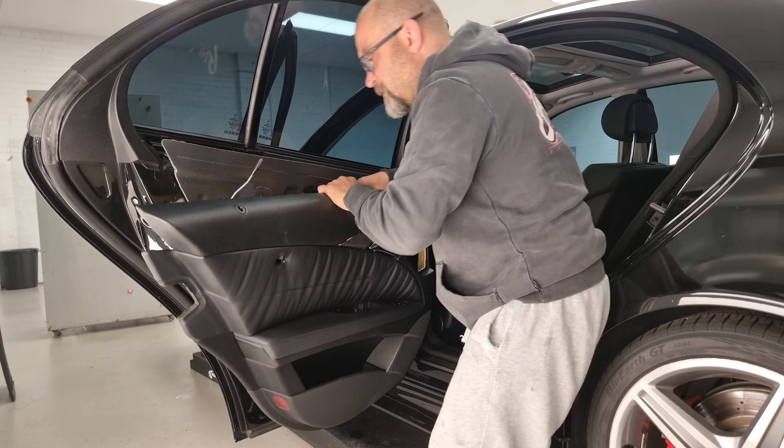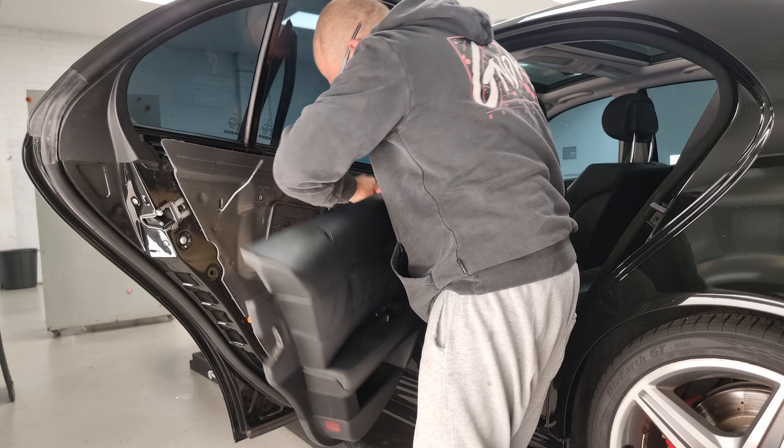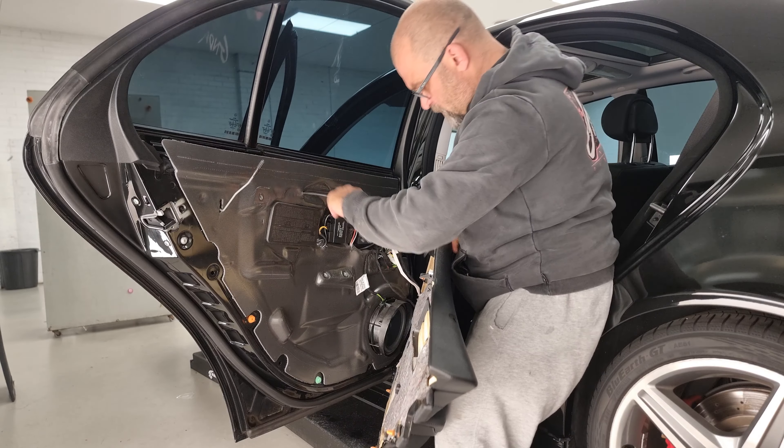To do that you do have your door cable here. This door cable will hook onto the back of the trim and then you stretch it out and it locks back into that little sleeve there. The actual plugs are pretty self-explanatory. There's a little tab on the right-hand side for this data cable. You've also got this speaker cable here - the speaker cable does actually disconnect from the speaker itself. And then you've got this cable here for your other switches - your power window switch and something else.